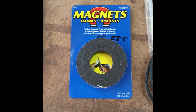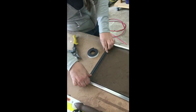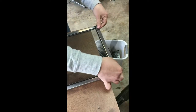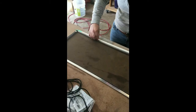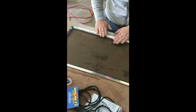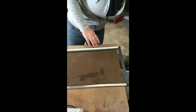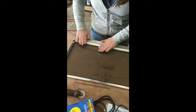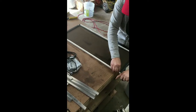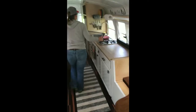The last portion is to put on our magnet tape, which helps it stick onto the metal parts in the bus. She's just going to lay it down here to get an idea of the length, then use a nice heavy-duty tin snips — makes it cut real easy. They say you can use regular scissors but tin snips work a little smoother. We've also got fancy sticky weather stripping tape to fill in a little gap on the top and bottom — one side sticky, just like the magnetic tape, other side not.